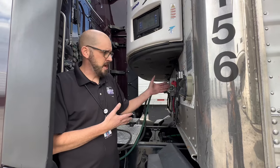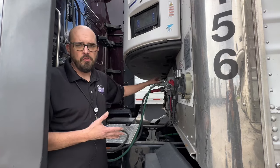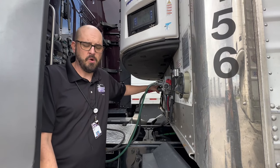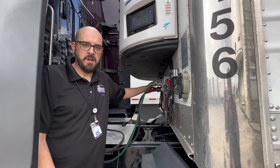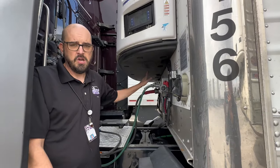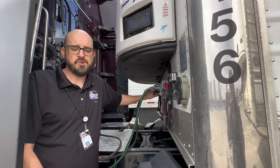We're not doing that right now — that chamber is still sprung, your parking brakes are still set. Because your parking brakes are still engaged, we've got this airline over on the blue side, which is your service brakes. So now we're doing essentially the same thing as if you're going down the highway standing on your brake pedal. Your service brakes are going to be fully engaged; we've got air going through your service airline system, so your brakes should be locked up on that trailer. Your parking brakes are engaged, and you've also got your service brakes engaged.